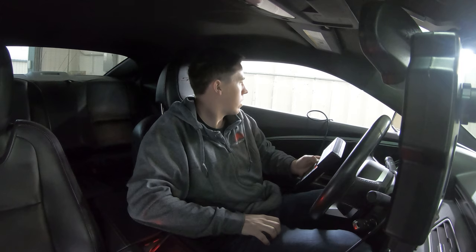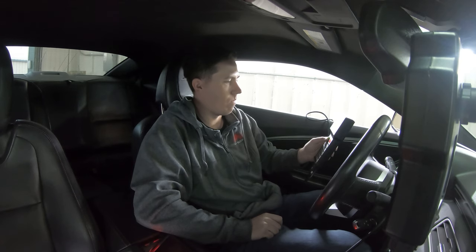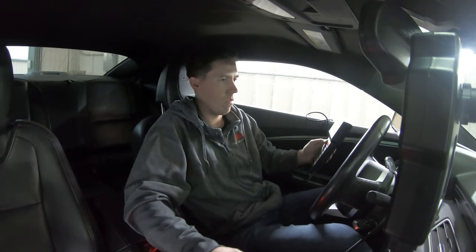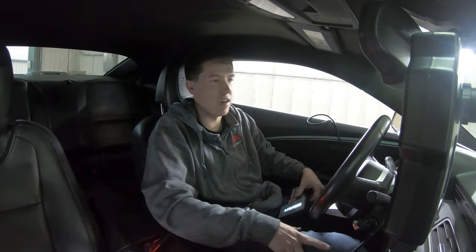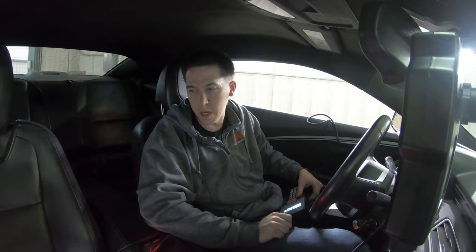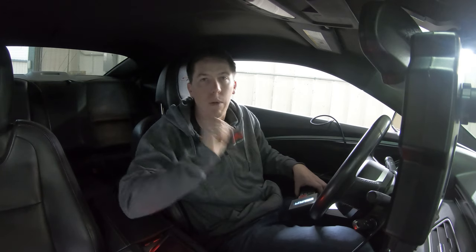I set the start mile an hour to about 50 mph, which is about 2,000 RPM. I'll watch for the start speed to get there and hit go. Got it out to about 6,500 RPM. That pass made 484 horsepower and 494 torque, so I picked up even a little bit more there. Fueling is within about 1 to 4%, so I'm going to call that good on fueling. It made really good power. I just need to look at timing — it looked like it started to knock just at the very top, so I'll probably pull one degree of timing out and make one final pull.